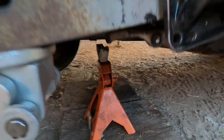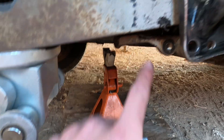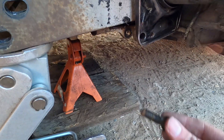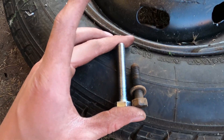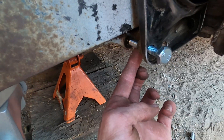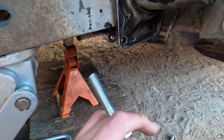I now got this jacked up to where it needs to be — we're about an inch or two off of the jack over there. One important thing is you want to get this back plate around the back side of this arm again, and right there you can see we're above the wedge now so I can start trying to get these bottom bolts in. The challenge is that it's really hard to get those bolts back in, so I went and got longer bolts. This is an M10 with a 1.5 thread pitch — definitely a lot longer — so this should be able to go in. I just need to get things lined up, tap the bottom to get it moved over, get the rear one started, get the upper one in, and then pull this one out last to replace it with the stock bolt.